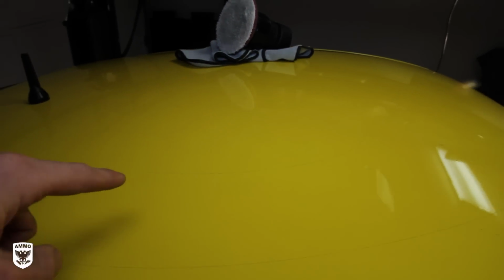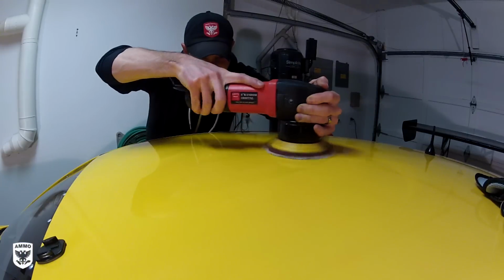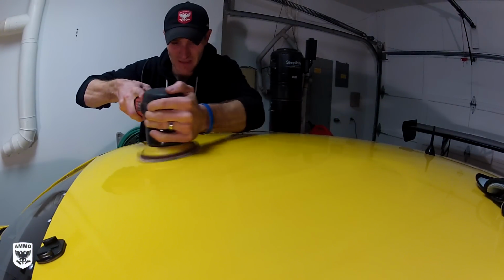But I'll take the microfiber cutting pad, and those little fibers will get in here and pick up all this stickiness. And you know what? It's just a way to save time to do it. I gotta polish the paint anyways, and it's got all this stuff on, and it's all scuffed up because it's a race car, so it needs a little love anyways. But this is just a bit of a tip. Why do an extra step if you don't need it and go through products, especially solvents? They don't smell good, and they're not really great for you, but they do serve a purpose.